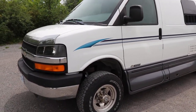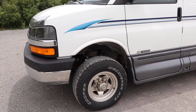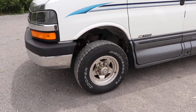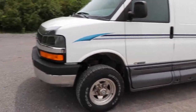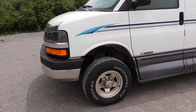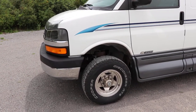Going with the spacer lift and spindle lift on this vehicle gives you a lot of height but it removes your wheel's ability to travel down — it's already pushed down two inches to begin with because of the spacer lift. So if you're heavy in the back or towing a trailer and go over a big bump, you can top out the shock — the wheel goes down as far as it can and gets bound by the shock. If you're driving really aggressively you could tear the end of the shock off, but it hasn't been a problem for me.